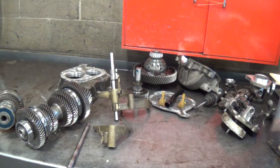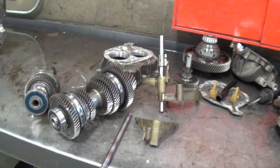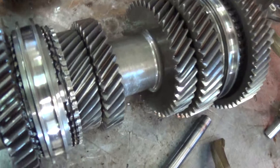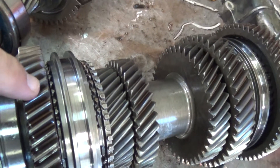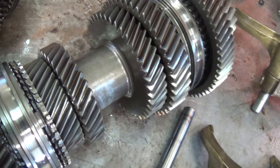Alright Tanner, here's your 2005 Dodge Neon SRT transmission — got it apart, got some bad wear on three different gear assemblies right here. Worn badly, this gear and synchro hub and sleeve has to be replaced.